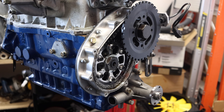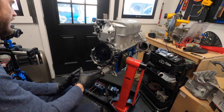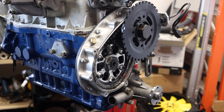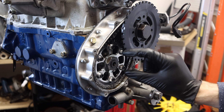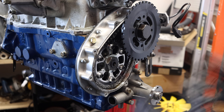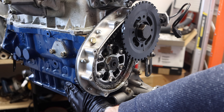We find ourselves in a bit of an unusual position — the engine is completely upside down. The reason we're doing this is because I am going to be removing the camshaft and replacing it with the new one from Avon Bar. For some engines, this might not be necessary. There are some engines with tappet covers on the back of the block that allow you easy access to get the lifters out without flipping the engine like this.